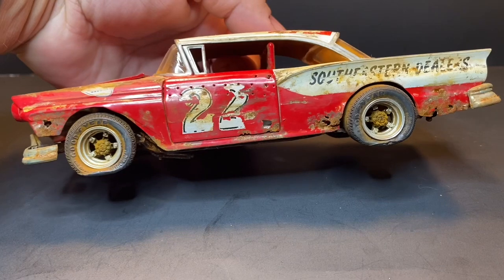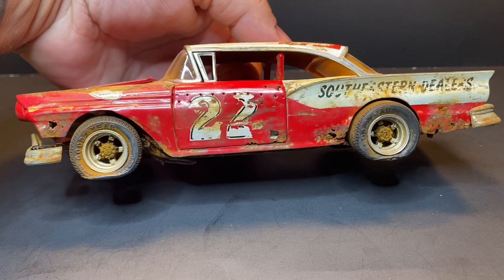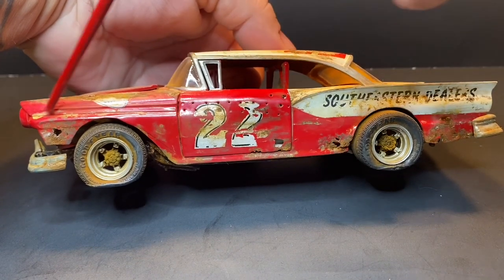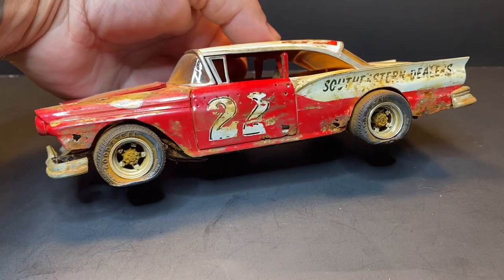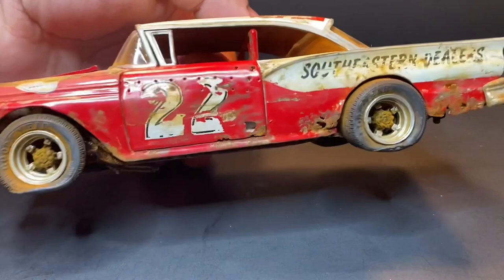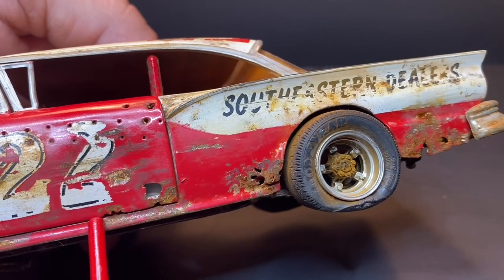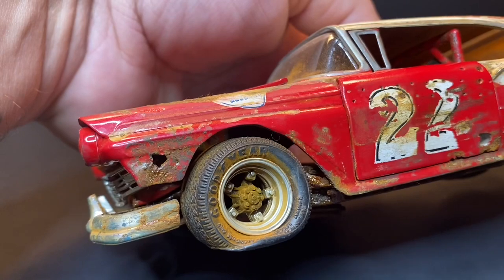Right about there you can see all the holes in the body side — in the door — where the chrome trim used to be. Up front the chrome trim has just been painted over, kind of like what they did back in the day: they just painted over the chrome trim or popped it off and left the clips on. This one also has got the rust in the rear quarters and a rust hole in the door. The bottom edge is rusted out, getting into the front fender.